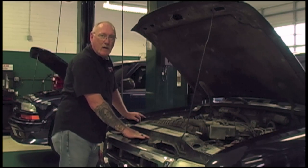For preventive maintenance, we'd recommend that in the neighborhood of 50 to 60,000 miles, the belt system be looked at. Rib cracking was a failure mode that was normal for older drive belts, but in the 2000 timeframe for the OE market and approximately 2006-2007 for the aftermarket, the materials were changed to a new polymer. So rib cracking is not as predominant as it used to be. Even though we say visually look at the belt and make sure there's no cracking or issues in the belt ribs, we should also check belt wear.